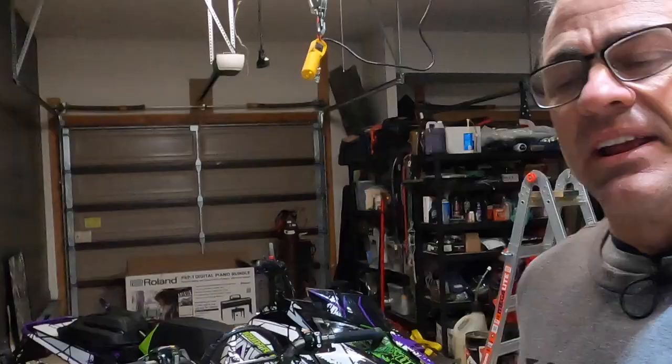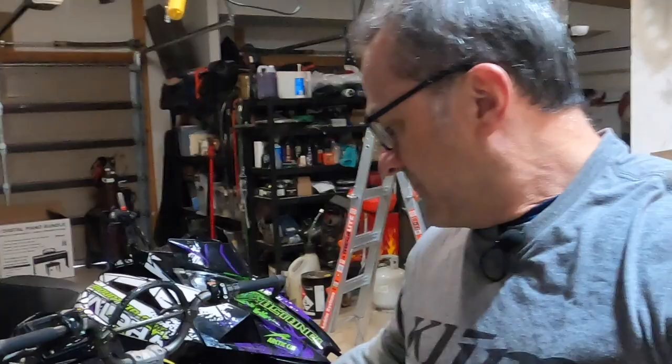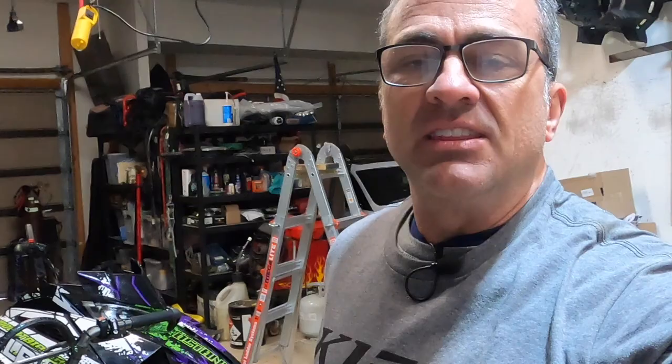So if you have a Polaris you need to buy one of these. Munster sells them — Munster is in Canada. If you're in the US and want to buy one, Force Turbos has them on their website for $40. There are also some aftermarket guys on Snow West and other forums that make and sell them. Some guys who are worried enough about their throttle safety switch on their Polaris actually buy one of these, keep it in their sled, and if they think it's a throttle safety switch problem they go in, unplug it, and just tape the bypass into the little bag so if they ever need it they know it's in there. Or they just bypass the throttle safety switch altogether.